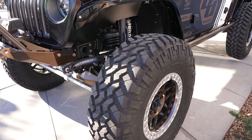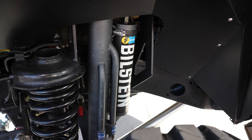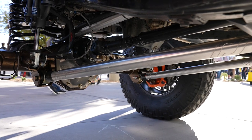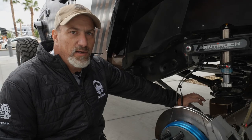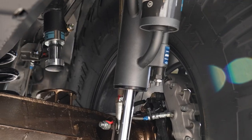Building this thing around a 42-inch tire, we really had to make sure we had as much up travel as we could get. We decided to go with Bilstein 9200 Triple Bypass, so we built the shock towers pretty high to maximize without cutting the body. We also did MotoBuilt's triangulated four-link in the rear and a three-link front. On the triangulated four-link, we decided to use the Rock Jock aluminum control arms with their new Rock Nut design — absolutely love these. They don't require maintenance; once they're cinched down, they don't come loose. We also use their Johnny Joints, and Bilstein bump stops in the rear to help absorb impact when driving fast through the desert and small boulders.